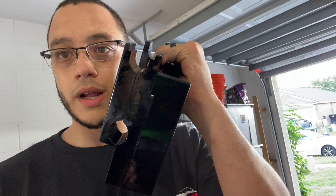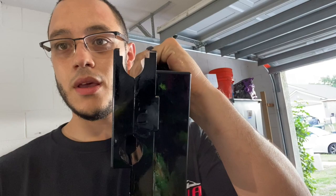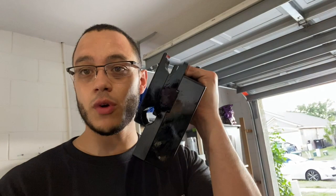There are these small notches, which are where this goes on the inner rail of the frame. The reason I believe they're there is the same issue I had with my last mount. Further back, there's a weld on the frame, which forced me to shave down the old mount because it wouldn't fit correctly. It scratched up my whole frame, and I kept having chain issues when I first put it together. I didn't know any better. But with this mount, you don't have to worry about it. It's already done for you.